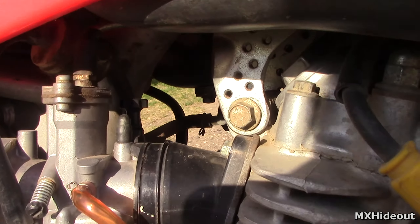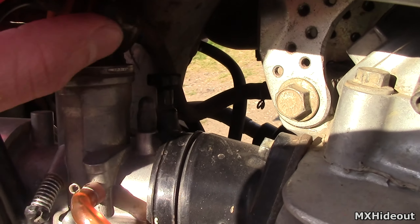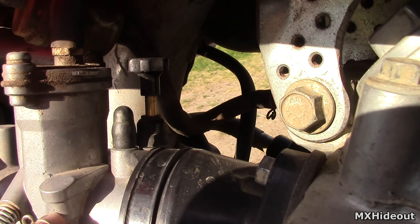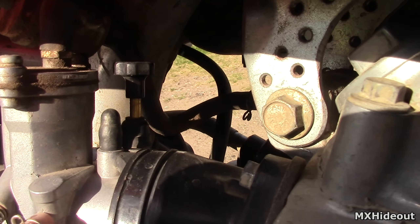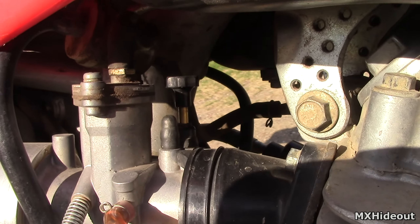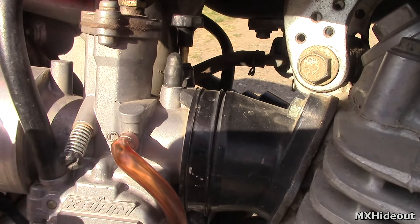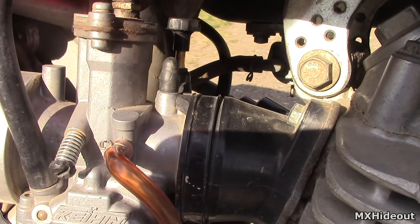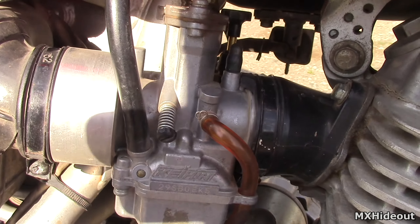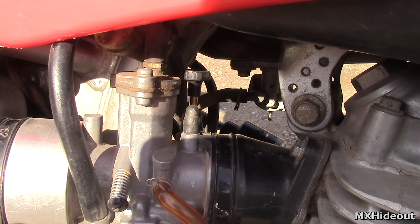After that, if the engine's cold, make sure that the choke is working properly. The choke knob is here — pull it up and it stays in place. It's hard to test on this one if the bike isn't running because there's no valve you can see. But on some bikes, if you pull the carb off the boot and look inside the bore, the choke will turn a valve and you can see it moving and operating.